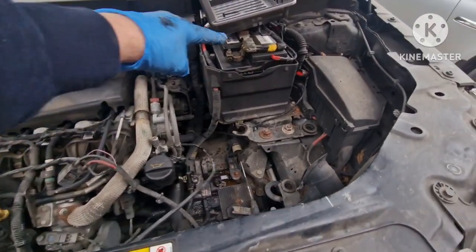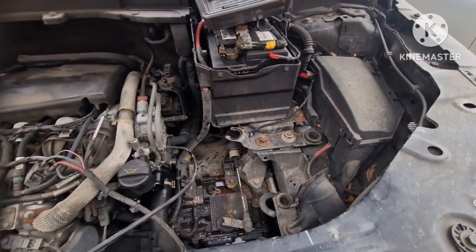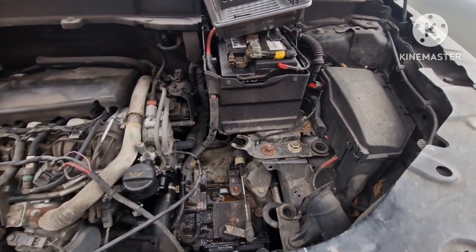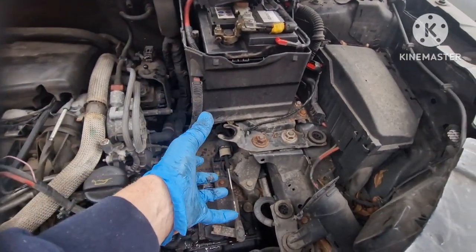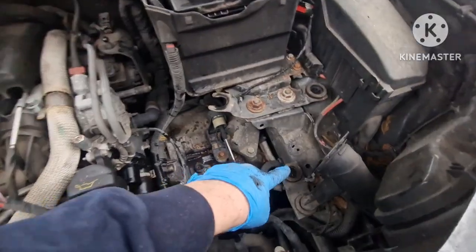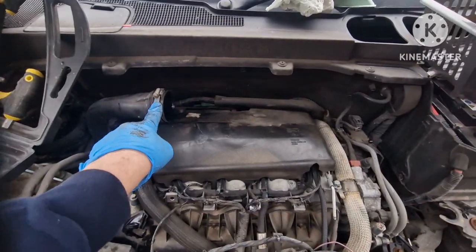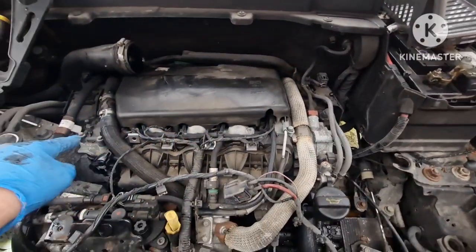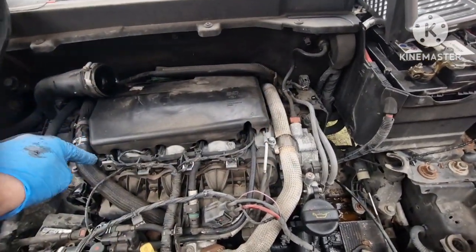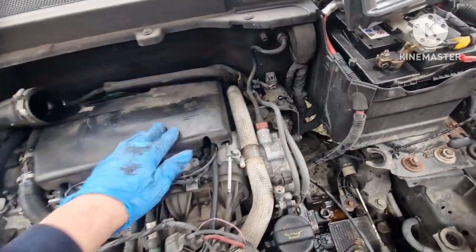Right, we've taken the airbox off, which was 4 torx screws around. Take the lid off, take the air foam filter cartridge out of there, and then that box section will just pull straight out. It's on plugs. You see the rubber plugs still on the bottom of the airbox. Got another one there as well, so just lift that straight up, wiggle it, and it'll come out. Undo the hose there, jubilee clips there, jubilee clips there, and holding the top down, there's the plastic cover, there's 2 8mm bolts, and then there's a stud on the back which was 10mm, but that'll probably come off with the cover anyway.